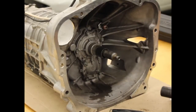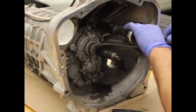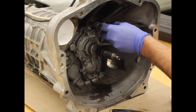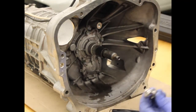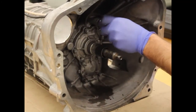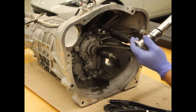If you are doing the reinforced pivot, now is the time to remove the OEM one. Grab a 19 millimeter socket and remove the pivot from the bell housing. Our strengthened pivot is a direct replacement — simply thread it in. Using a torque wrench, torque the pivot to 12 foot pounds.